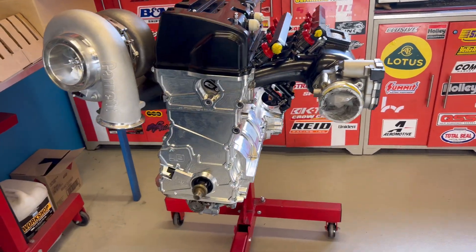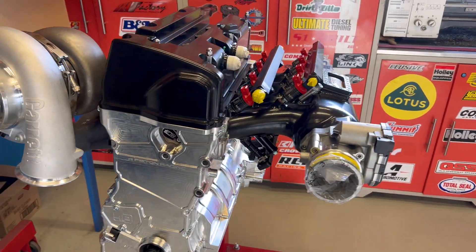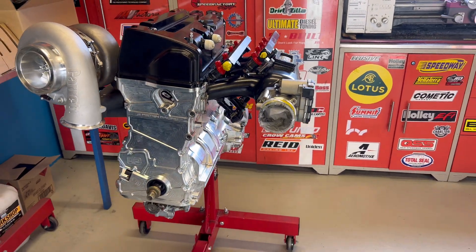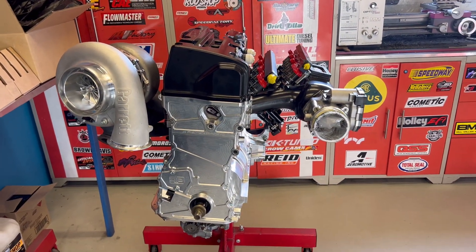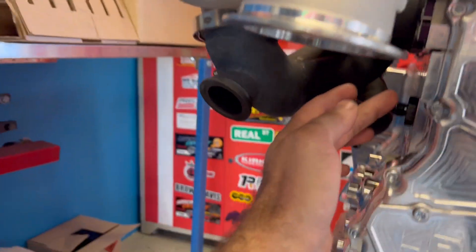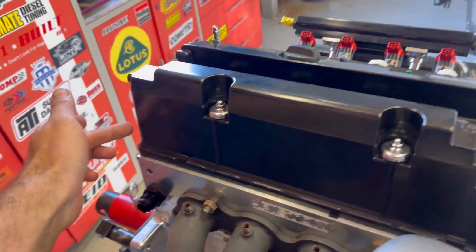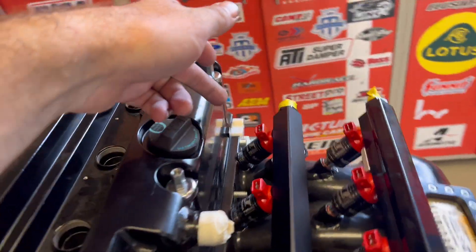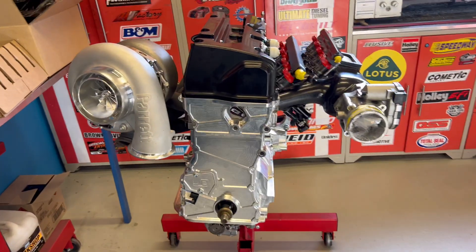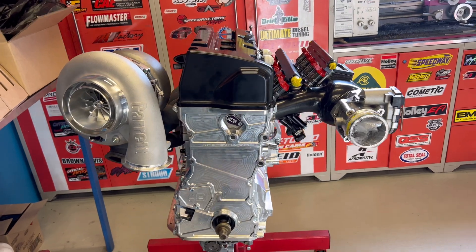Head gaskets were our nemesis all last year. Anytime we'd put 38 pounds in it we were fine, but anything over that we started seeing big coolant pressure increases, so that's why we've done the whole dry deck thing. Everyone goes 'oh, you can't drive that on the street now,' but you can. Water comes in the block through here, travels around the block, down the other side of the engine, out the back, and then up into the head here. Hits the deflector plate we showed you earlier, travels around, pops out the top and goes back to the radiator. So it's still full water — there's water in the head and water in the block at all times. The best thing is there's just nothing, no water in between the head and the block to cause any issues at all.